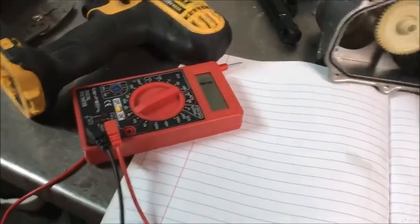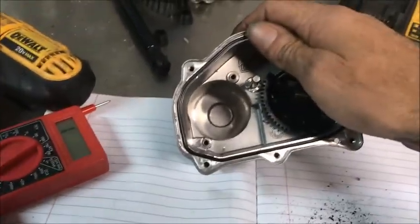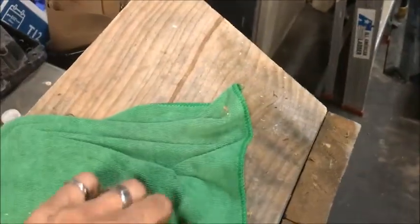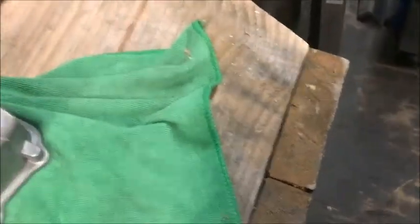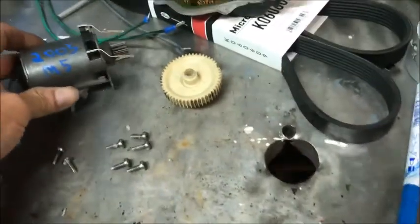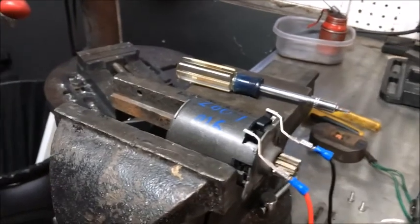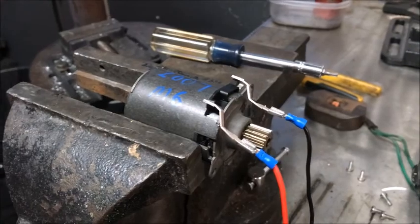To remove the motor, you just have to take the two screws that hold it in — there are two screws right here and right there. No amount of prying is going to get that little fella out of the hole, because the back of the motor actually seats down into a pocket in the bottom. The only way to get it out is to take the two screws out, then get a block of wood and a cloth to wrap it, and with the motor in there just hit it as square as you can. Hit it about three times perfectly flat and the little motor will fall right out — so you don't damage anything and don't have to worry about prying.